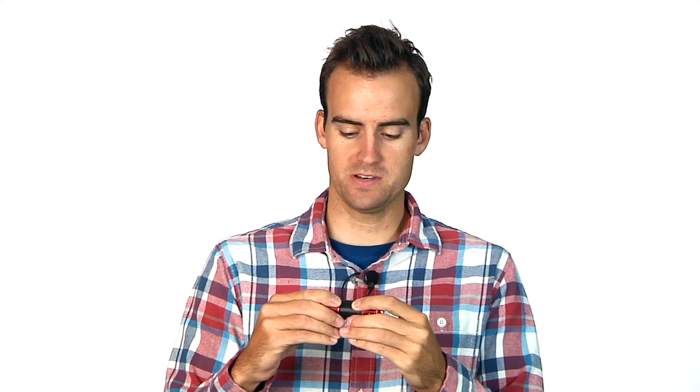As good as they rolled before with the steel bearings, now they roll even better. The advantages of ceramic: harder balls so they roll faster, better durability, and with King's in-house made stainless races you get a piece that rolls super smoothly. With King's grease injector you can easily re-grease these in minutes. And one of the best parts is it has the same warranty as the steel bearing model — five years — which is just unheard of for a bottom bracket.